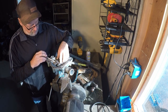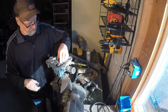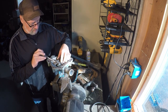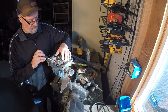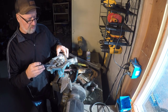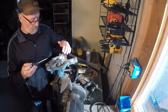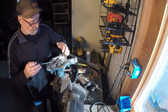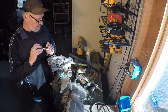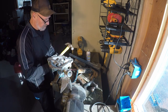First thing we want to do is tighten the vise so it doesn't fall. Make sure the impeller is equal, that these aren't bent up, bent down. The lowest clearance, the minimum will be 40 thousandths, and some of these others may be 42, 45, whatever. That's the one I'm going to measure as I send this thing down.